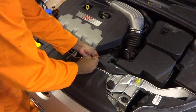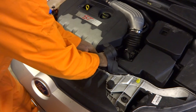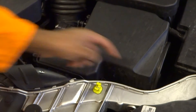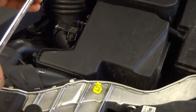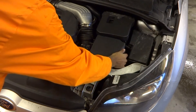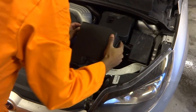Remove the flexible rubber holders to free the air box. There are four 7mm bolts that hold the top of the air box on — one here, one here, one around the back, and one more. Remove those with a quarter-inch socket drive with a 7mm head and an extension. Once they're all loose, pull the top of the air box off.